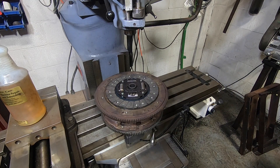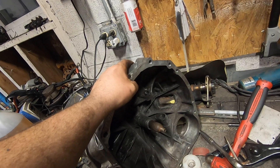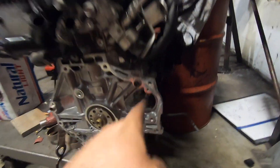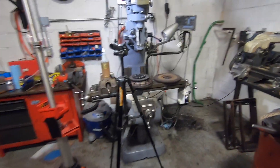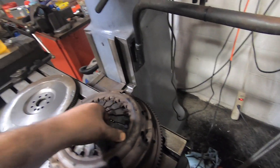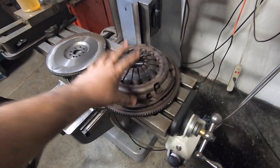However, we have a solution. We're in a unique position where we have options with starter mounting locations. The Subaru transmission has the starter hanging over the transmission, whereas on the Chevy Cruze the starter hangs over the block. So I have two unique starter mounting locations, which means I could also use a Subaru diameter ring gear. That led me to think: why don't we just give the entire Subaru flywheel, disc, and pressure plate combo a try? I'd like to use this — it's very cheap and affordable, and they're literally everywhere.